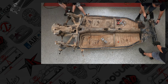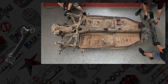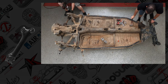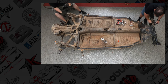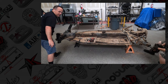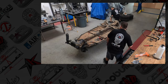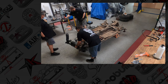So on the pitman arm, there's going to be a bump on the pitman arm. And if you tag it right, you're just going to loosen the swedge and it's going to pop right off, just like it did there. You don't have to hit it hard, but you have to hit it right and solid. So we're not going to be using this steering box at all. It'll be a core. The pitman arm is junk. The steering box clamp is a good core.